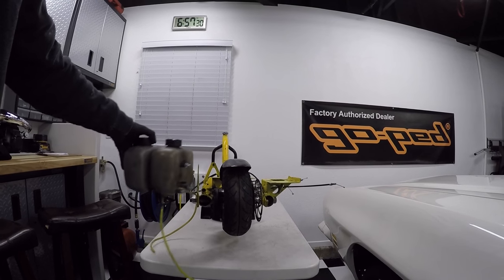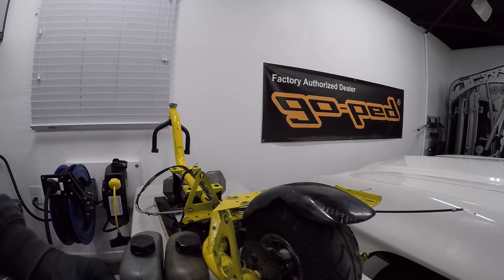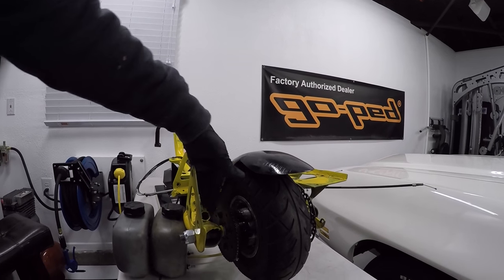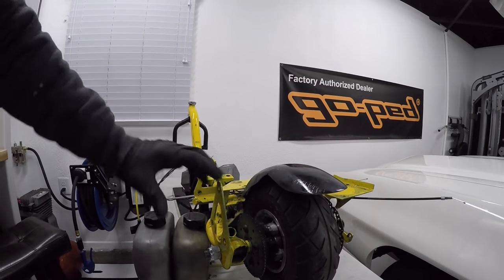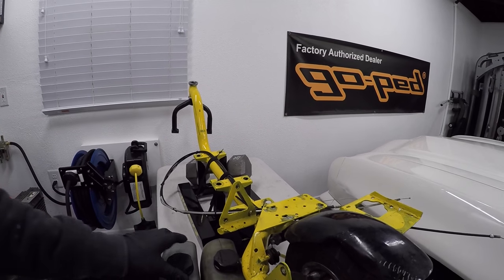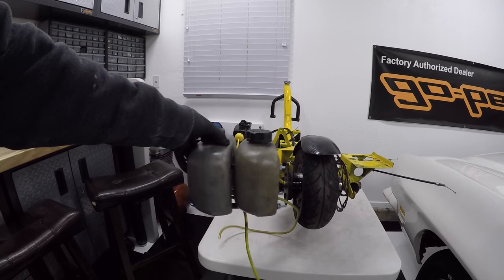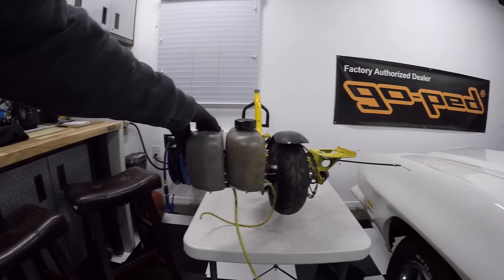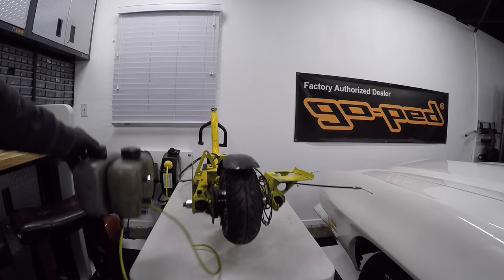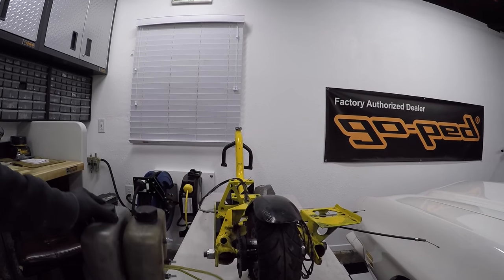So I need to modify this little bracket. When I go down in a couple days later this week, I'm going to be having this bracket modified, brought over, basically cleaning everything up on the pad — cleaning all the welds up, just really clean it up and make it look nice. Ideally, moving this bracket over to give myself a bit more lean angle for what I'm riding. Might even bring this bracket up a tad to give myself some more clearance.